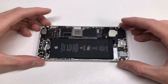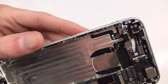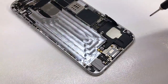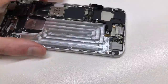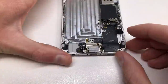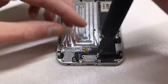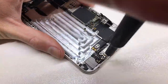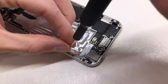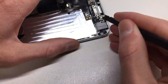As you can see, I've already robbed the vibrate motor off of it, which I used for a previous iPhone 6 restoration video. You can see that the power button cable is actually ripped on this device from a previous repair attempt — likely from someone trying to pry up the battery after breaking the adhesive tabs and forcefully removing it. The power button never worked when I bought it, the battery wasn't even glued down, and the iPhone was missing many brackets and screws. So I'm going to be parting this out and transferring parts over to the purple housing.